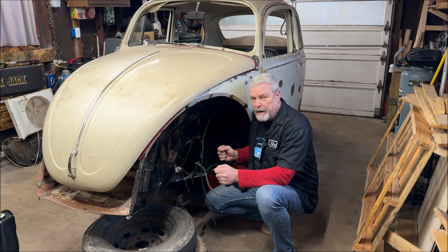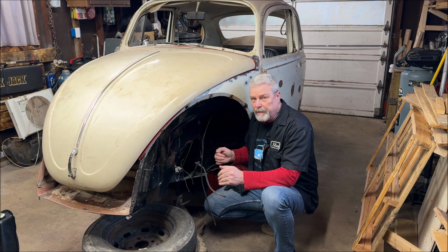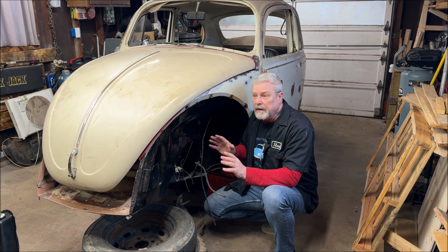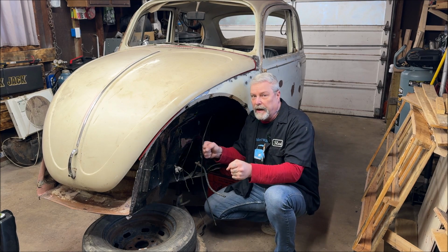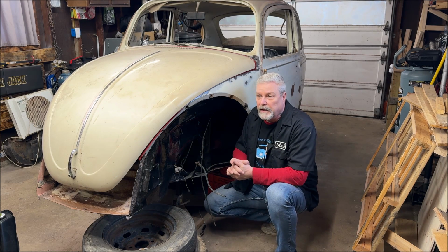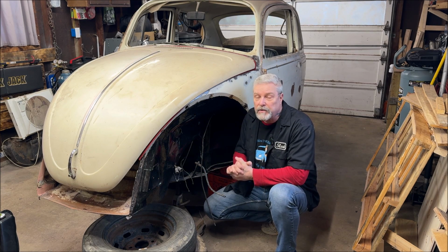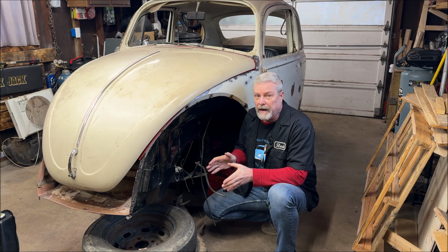When your wheels sit back further, it causes a negative caster. And that's from the factory that way. That's when it starts wandering around the highway, around 60, 65, or sometimes you'll get a steering shake. And yes, it can happen. If somebody comments and says, never happened to me, that's great, I'm glad, but it can happen.